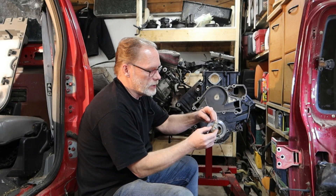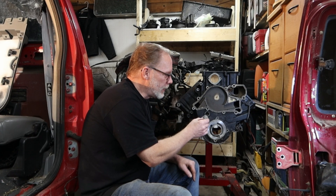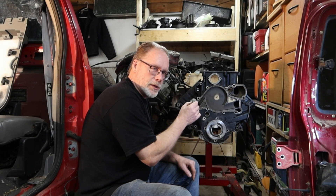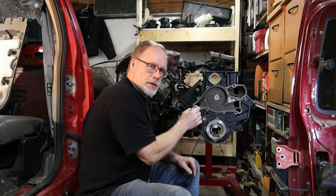Right here is your cam sensor. It is critical that when you install it, you put just a little bit of grease or oil on it and make sure it clicks — it pushes all the way in, nice and tight. If this sensor is sitting kittywampus or not far enough in, it's either not going to start or it's just going to run poorly.